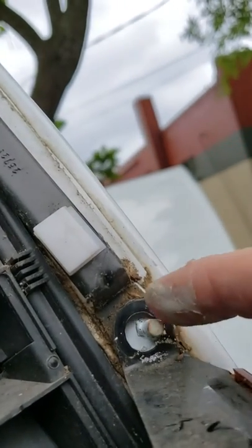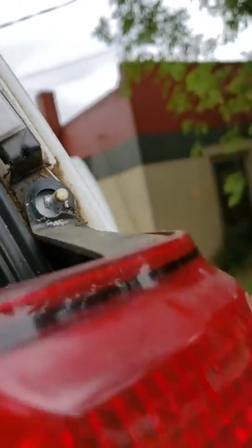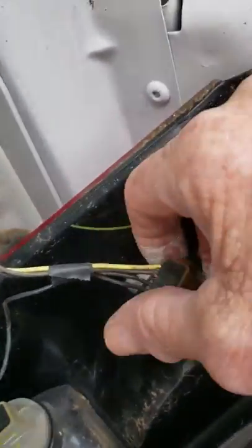When you do that, you've got one more nut right here — 10 millimeter — that you have to take off to get the light. When you do that, just pull it and then raise it straight up. It's got a little pin right here it sits in — see that little hole.